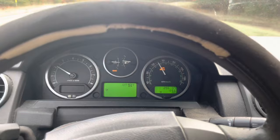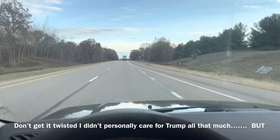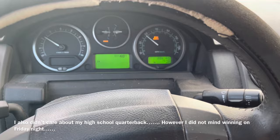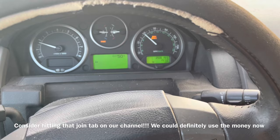Keeping a very safe distance from other drivers is an extremely good idea because you have a lot of inertia and weight that you need to stop — stopping the vehicle quickly definitely doesn't happen in this situation. You're towing a considerable amount of weight and what you might notice as you're towing is your transmission not shifting like it normally does. I recommend not pushing it real hard. You don't have to take off very fast, but you can let your foot up off the gas and it will shift gears. Try to keep the RPMs below 3,500 when taking off so you don't overstress the transmission.